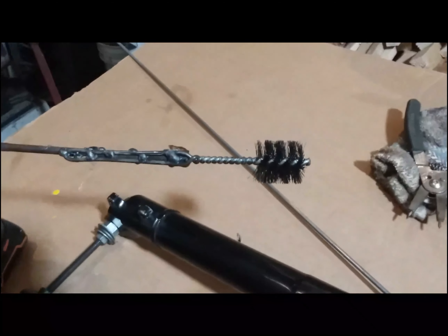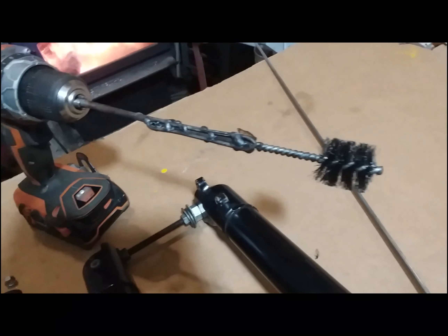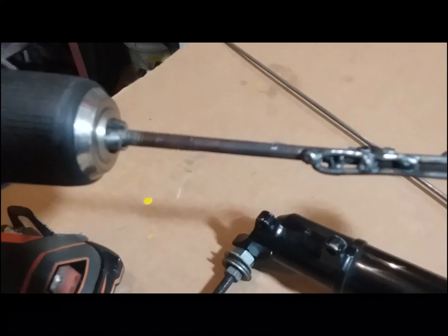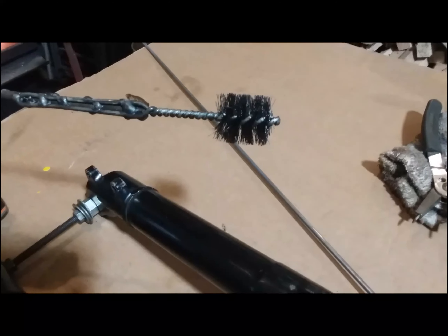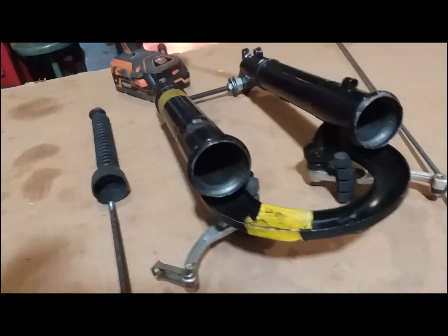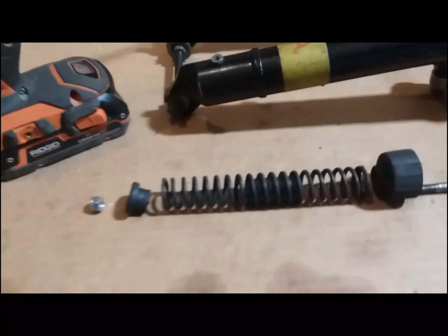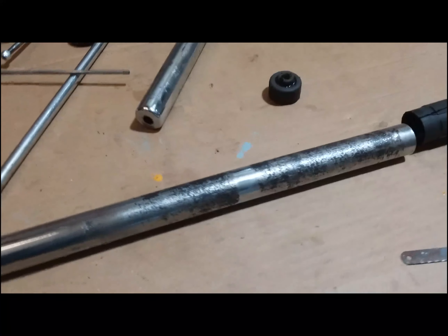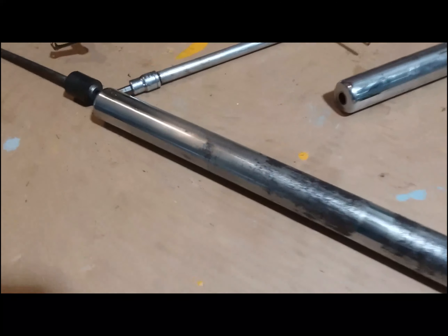There's another bushing - I had a hard time getting that bushing out. What I did is I took a hacksaw blade, just put a slice through it, and I was able to peel it out of there. That's not going to matter when I put it back together. Then there's a seal and then a snap ring. To get it out was a real challenge - first thing you have to do is remove that nut, then you just pound on it with a piece of wood so you don't damage it and try to pop it out, but that didn't seem to work.